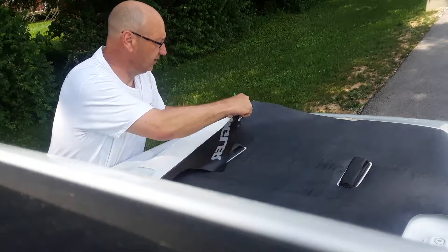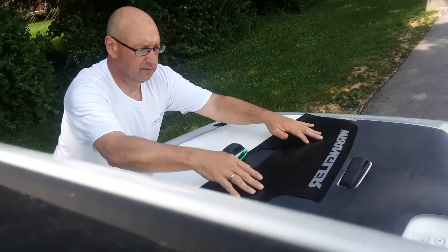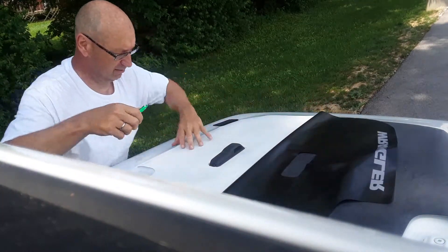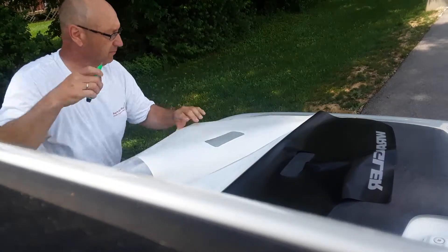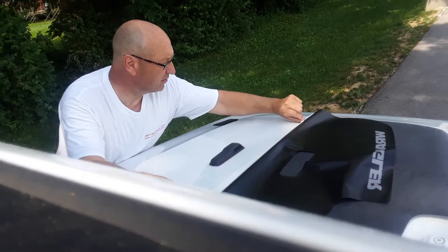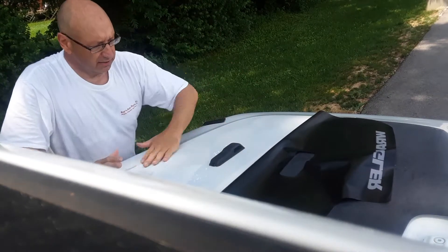You can see I'm under a shade tree — it's cool. A real hot day would not be a good idea. I'm going to take my knife or a pair of scissors and come across it, then discard that. I'll take my finger along this line here and make sure there's no little fuzzies that get caught up under there — and they will, because it is static, it's clinging to the stripe. Make sure there's no little tree fallings or anything that's fallen in there, or gnats.